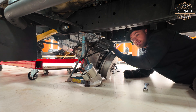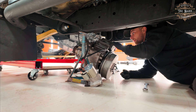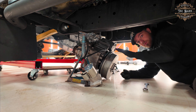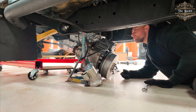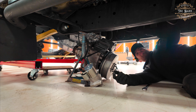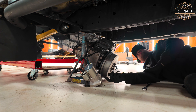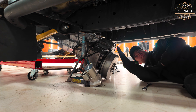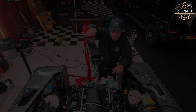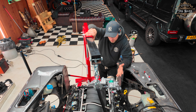The transfer case is now attached to the back of the gearbox. What I will do from here is jack the back of this up — and as I jack this up and let the front down, because of the front hanger angle it will push itself further back into the recess. I need to come another five inches further back and then I can mount this in place. That will be the right distance into the back of the engine bay, and then I just need to set the height at the front. Transfer case is bolted at the back and we're at the right position with the engine.